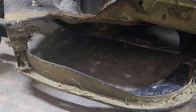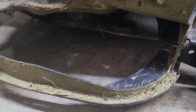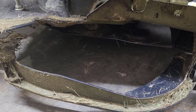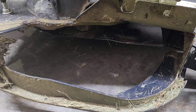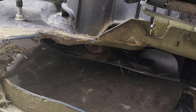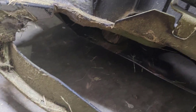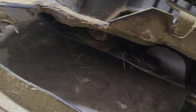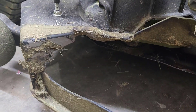I have a Cub Cadet. What I did here — here's my chute — I rotated the blade to where it's pretty much parallel to the actual tractor. I want to zoom in a little bit here. You can see the rear tip of the blade back there and the front tip of the blade here. You need to make sure your tractor is parked on a level surface, then measure the distance from the ground to that rear tip and to that front tip of the blade.